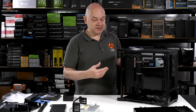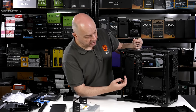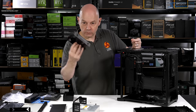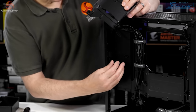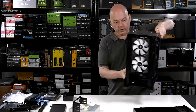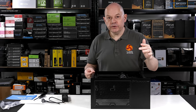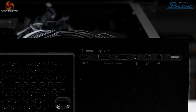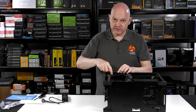Options are good and it makes this case stand out. The one thing you cannot do in terms of storage with the Mini versus the Pop is put one of these 3.5-inch drive mounts there. The reason is this case is shorter than the Pop — one of the selling points — and if you were to put a mount there you'd be completely blocking the cable management slot. Other than that, the Pop Mini has most of the features of the Pop. The front IO panel, which is on the top of the case, is quite basic: USB 3.0 Type-A ports, a blanked-off Type-C, an audio jack, and power and RGB buttons, since you can run the RGB fans off this button by linking the fans to this header.